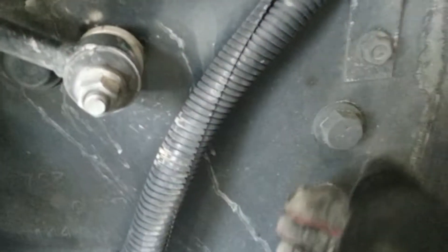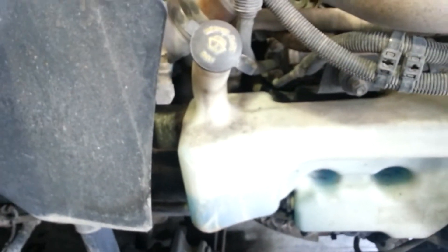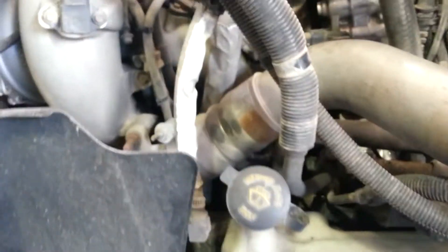You want to check your vehicle frame — no illegal holes, no cracks. I need to buy some windshield washer fluid because that's getting low — that's where you put it right here. This is another filter. I'm checking my lug nuts and bolts, checking the hoses, making sure they're not frayed, cracked, or leaking. Tugging on my belt — it should have no more than three-quarters of an inch of play from the center of the belt.